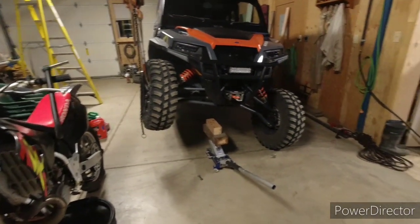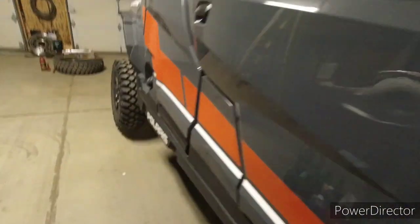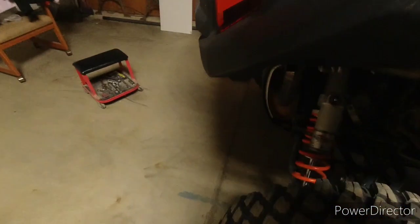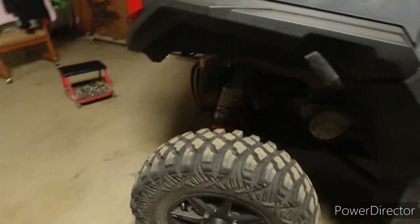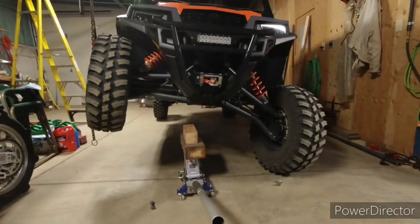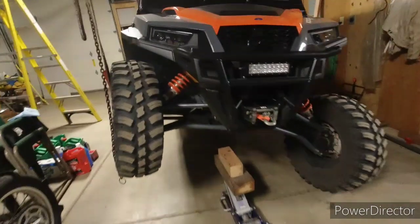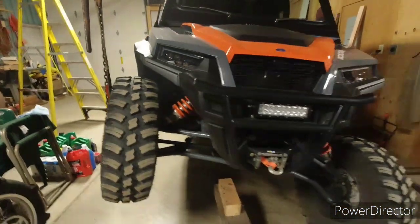Here's the last one I'm trying: the rear is reconnected, the front sway bars are disconnected. Now I have 16 and 3/4 inches at this spot. This tire wanted to come off the ground and this tire back here was still planted. How much twist do we have in the front suspension? Pretty decent twist. That bump stop is just a hair closer than it was last time, so that means there's more resistance. That one's obviously fully extended.